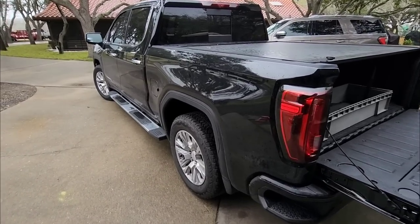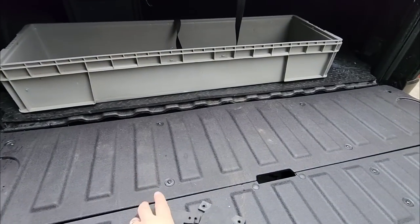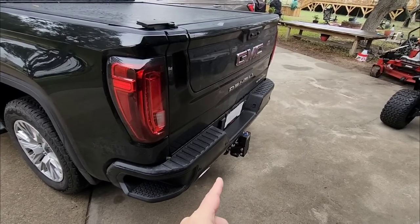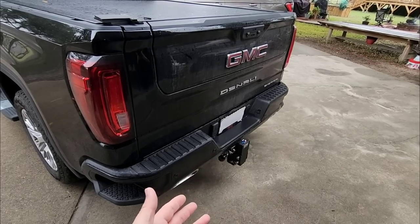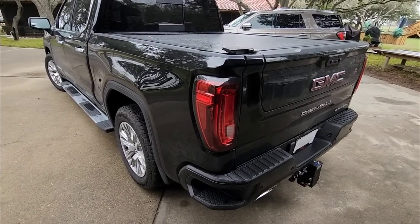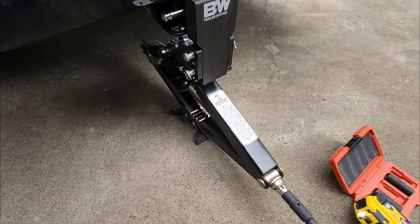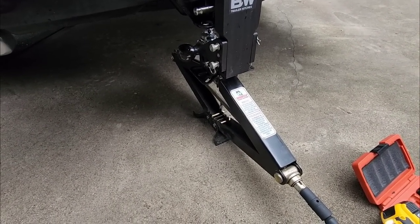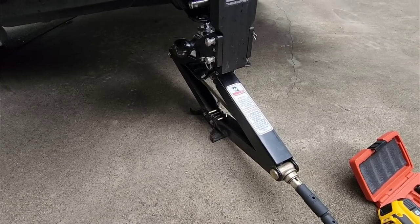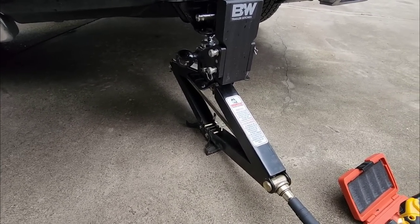If I lift from the differential, unfortunately it's not going to do anything to the suspension — I need the suspension to completely drop down. So we're going to put a jack underneath the hitch that's back here. This thing is rated for about 10,000 pounds and this truck certainly doesn't weigh that in the back. We're going to chock the front tires first, lift it up, and see if we can get the back tires slightly off the ground to spread apart the leaf springs and put these bushings in place. I have a 7,000 pound Husky scissor jack — far heavier duty than a traditional stabilization jack.